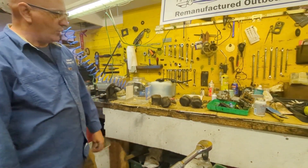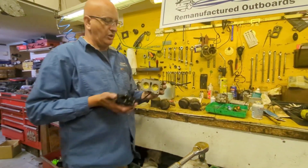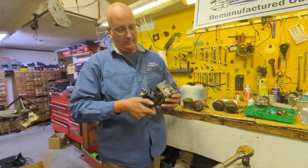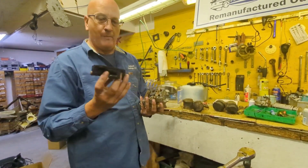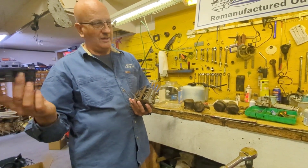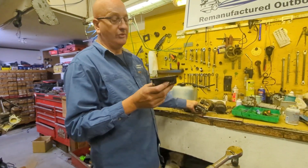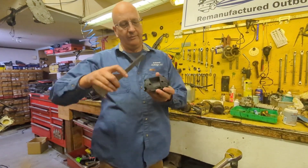The next thing we noticed is these have plastic-based carburetors. They only did this for a few years — they found out it was bad. This is the base of the carburetor. The seal here gets compromised because the plastic base — it was originally aluminum. In about 1988 they made it out of plastic, then went back to aluminum. What's that tell you? They figured out it was blowing lots of motors — probably haven't paid for it out of your own pocket. The reason it blew the motor is the base would warp.